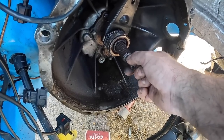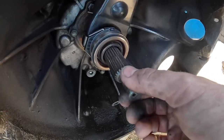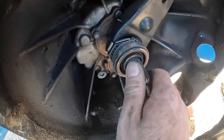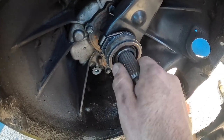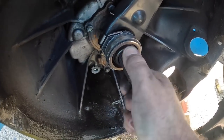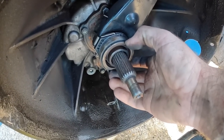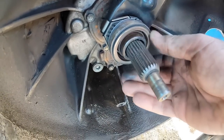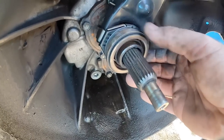There is a little bit of wiggle on the input shaft, and when you do wiggle it you can hear the noise. And if I turn it quickly, there's definitely a noise. The clutch release bearing does feel like it wiggles a bit, but when I turn it it's absolutely smooth. I will replace that clutch release bearing anyway. It looks like I'm going to be trying to fit the other gearbox — let's go have a look at the other gearbox and see if it makes the same noises.